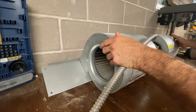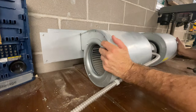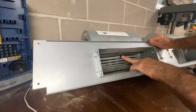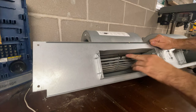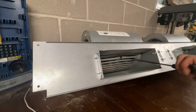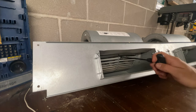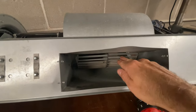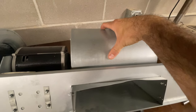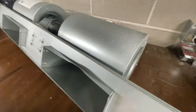We've got arguably one of the worst designs I've ever seen for a blower motor. I can't find any videos on YouTube on the best way to do this. Through this hole there's an allen key where you have to loosen the shaft from the blower wheel — this is going to be a 4-millimeter wrench. I'm going to loosen this up, loosen the other side as well, take these screws out, remove the squirrel cage side cover, and then the squirrel cage should be able to be removed.